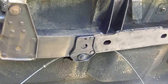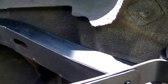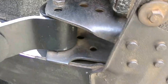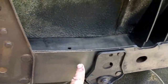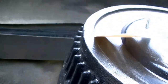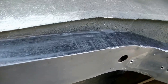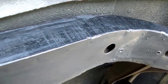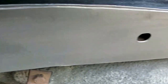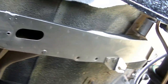A quick shot to show you what it looks like in this back part on the passenger side before I spray the brush stopper. This is all with just a wire brush and Scotch-Brite. Pretty much from here over to the end — up here is still factory paint. I guess that was more mud and dirt than anything, some light surface rust. But you can see how clean this came out just with 20 minutes of wire brush and Scotch-Brite.